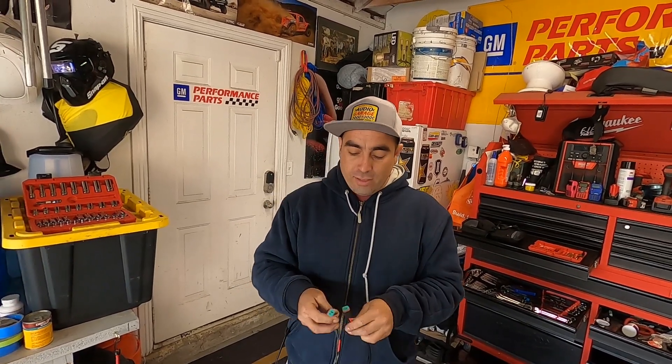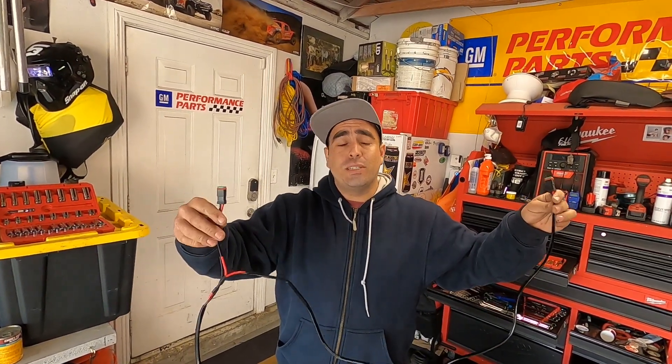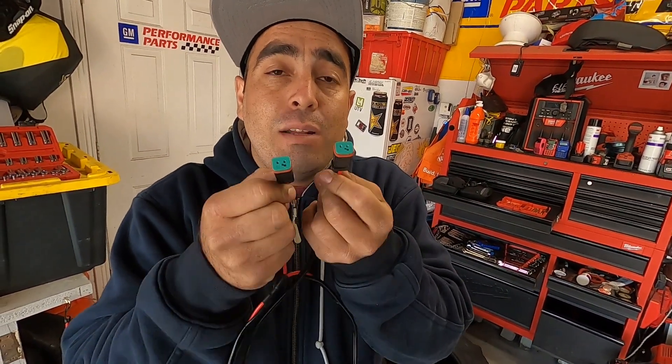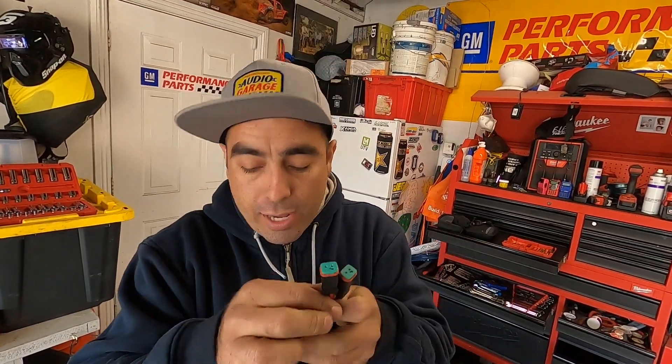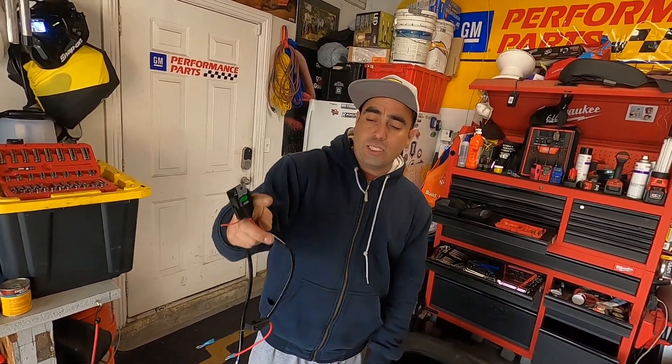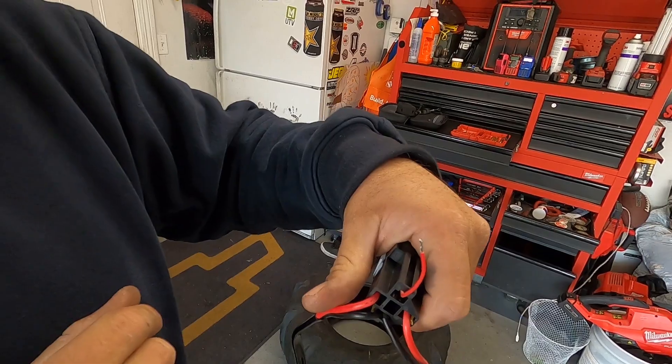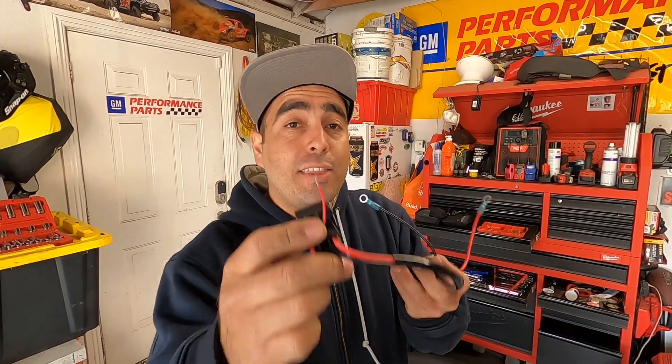Alright guys, we came inside because it was windy. This is the harness I'm recommending — it's in the description, there's a link for it. The reason I'm recommending it is because the connectors on the harness actually match the connectors on the light pods, so it's going to work perfectly. At the very other end it's just pretty much a relay. It did come with a switch but I cut off all those wires except for the control circuit. This control circuit is going to turn on our lights.